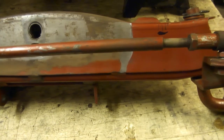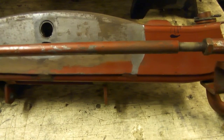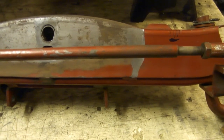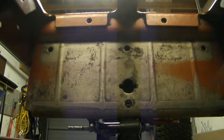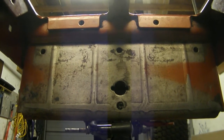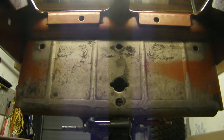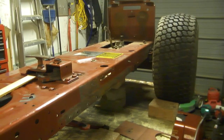That gets it back in the original position - that's one of the few rules governing the suspension in the racing class we're looking at: you have to maintain the original wheelbase. The reason we have to notch the front axle is to let us clear this jut out here. We can't really cut that out because it's pretty integral to the frame - it's also how everything's held together in the front. So we're just going to trim out the axle to make it fit around that.